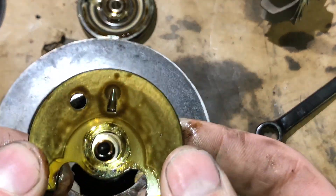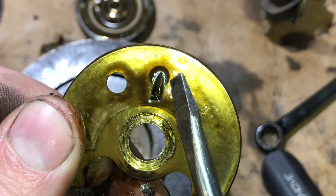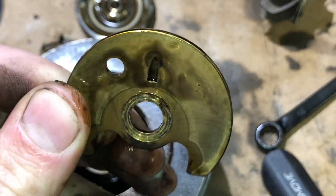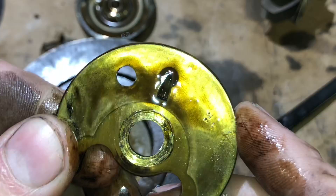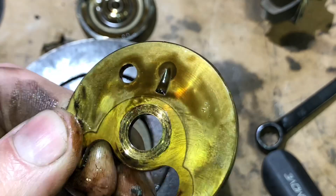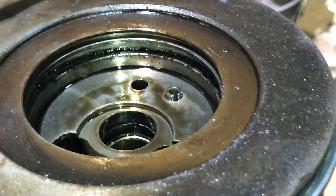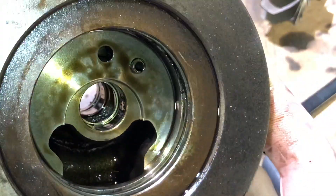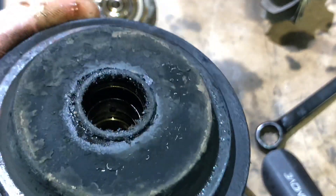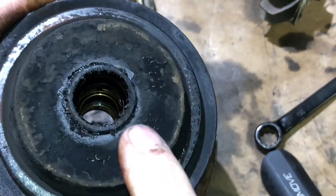There's the bearing. It's messed up right there. Usually at the top here, if it has a contamination problem, it'll have all kinds of particles and it'll block that thrust bearing off. I don't think that's really what happened here. The shock of the turbine wheel rubbing against the housing caused so much vibration it just started to wear it out there. Bearing seats look good — that's good news. These bearing seats look good on this side too. It just needs a good cleaning.